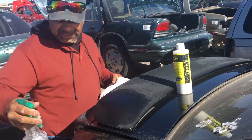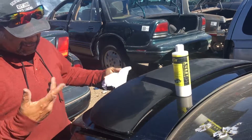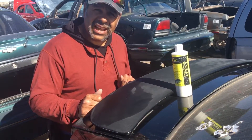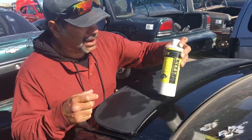Clear coats, fiberglass — they all have that in common. When they're still good, they'll look good when they're wet, then they drop and get ugly again. So right now it's getting ugly again. This is oxidized. You don't want to wax this, you want to clean it.